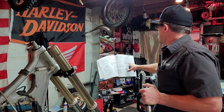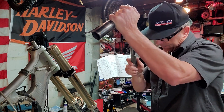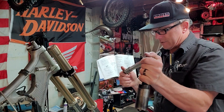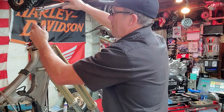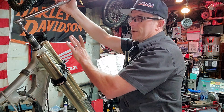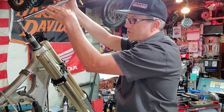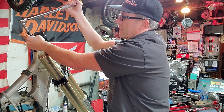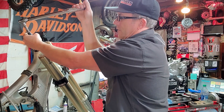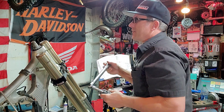So it says we should do an initial tightening of this steering ring nut to 27 foot-pounds. We set our wrench, lock her down, and bring her around. What this is doing is squeezing the bearings together — they need to come together some, because this upper one is not screwed to anything, it's just slid down in there. Bring her around, listen for the click on your wrench, or if you have one of those expensive ones that beeps when you get the torque, listen for that.